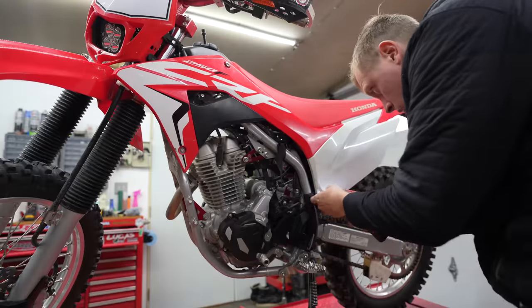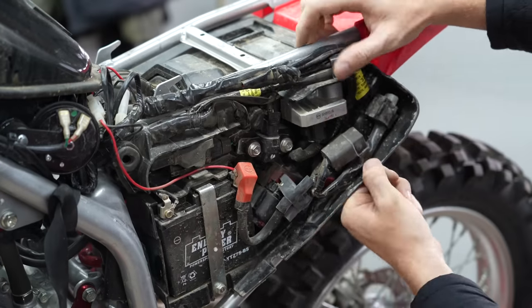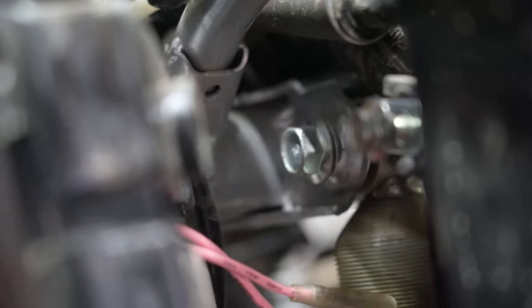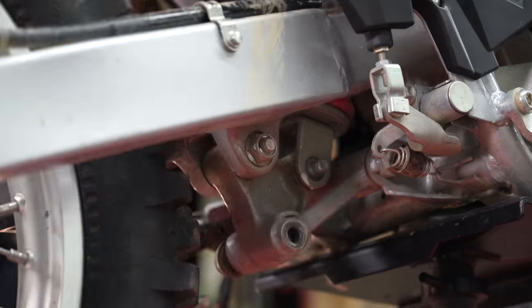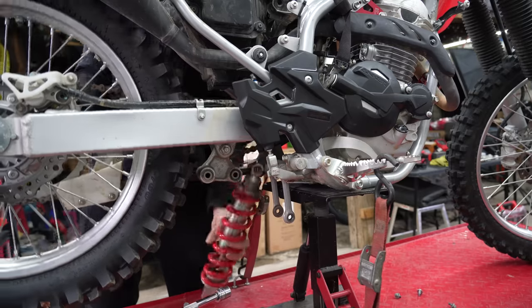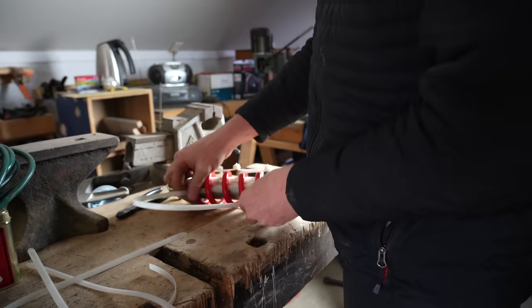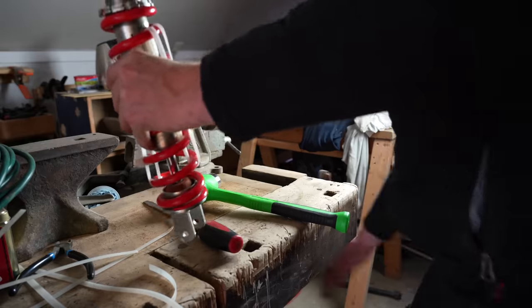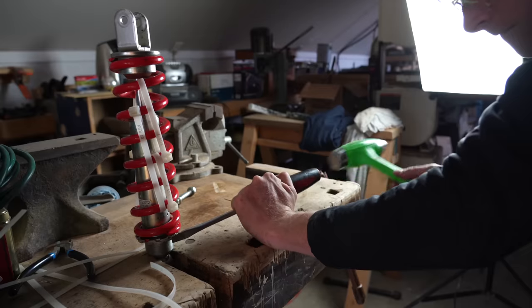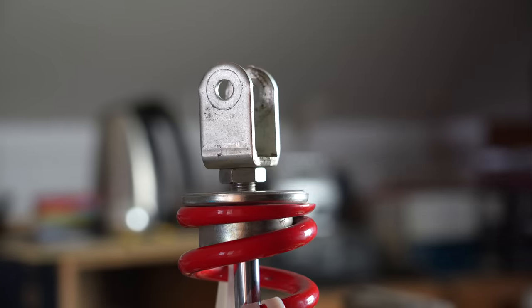You're going to want to take the plastics off to get to that top mounting bolt. You need to loosen the battery box too so you can squeeze in behind there, but you don't need to take it all the way off. Go ahead and undo the linkage — lift the swing arm up and the shock will drop out. Now this is definitely going to be frowned upon but you can do it safely. I do not recommend it though so don't hold me accountable. The spring compressor that I had did not fit this shock so I used the old zip tie method. Just go ahead and tighten down a bunch of zip ties around the coil spring, then you can loosen the spanner nut to get the tension off of the spring and now you'll be able to get to that clevis.